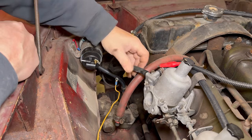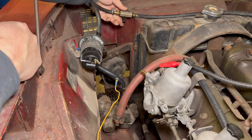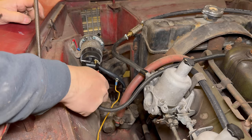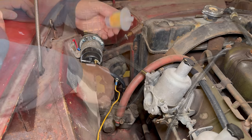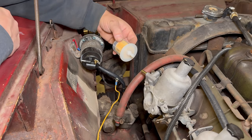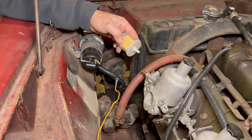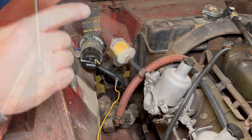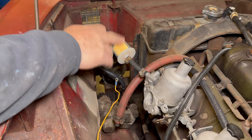The new pump is hooked up, so I can disconnect this. I'm going to put some fuel into the pump so it's not dry when it turns on. Let's put some power to it and see if it works. Next, I'm going to be installing a fuel filter right in here — this I just picked up at NAPA. These are directional, so take a look at the way that the arrow is pointed — it has to go in this way. In theory, I should just be able to put fuel in the tank and it should come out here now.